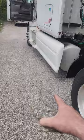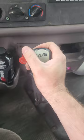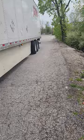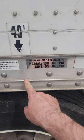So let's say we're setting it here — one, two, three, four, five, and six. We need to move it a little bit more forward, like maybe here. Then we're just going to go ahead and back it up until we feel that rock. Let's see if that did the trick or if we need to go forward or backward. The mark is here at the center of the tire, so now we just set the tandems and go forward.